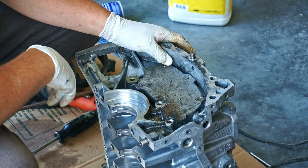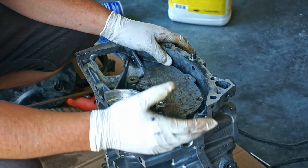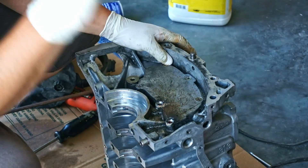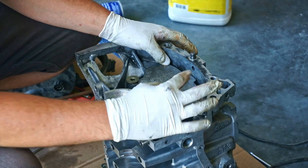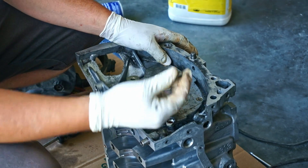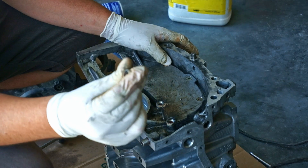This is a trick a lot of guys use on aluminum cylinder heads. A 5.7 Hemi will have the studs shear off — they'll break off flush, the exhaust studs, in the aluminum head. You take a good nut, put it over that broken-off stud in the cylinder head, weld the center of it to the nut, and then you can get your wrench on the nut and loosen it off. This is a chinchy skateboard kingpin nut with a nylock on it.